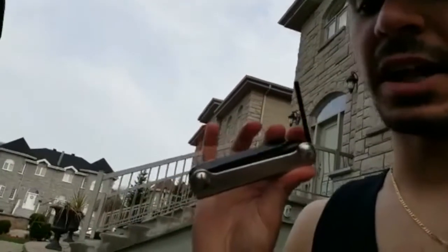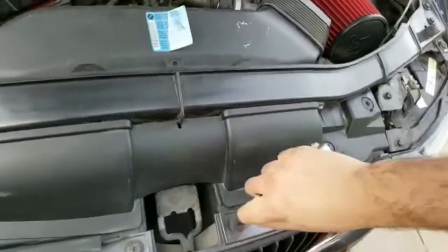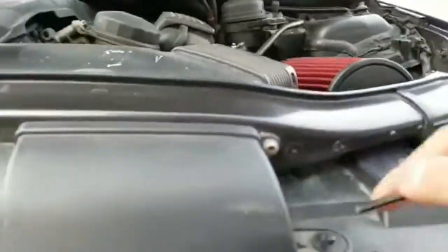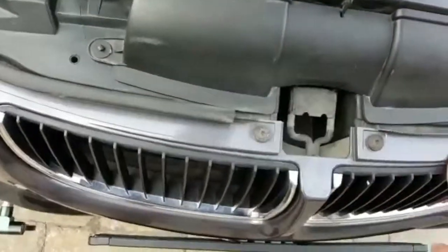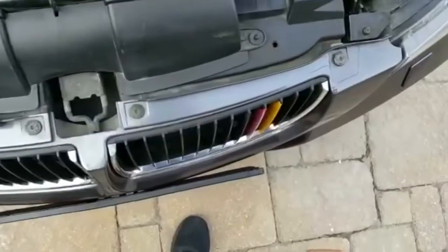I lied, we're also gonna be needing an Allen key — I don't know what size this is but it's best to have an Allen set. You're gonna need to take out these four bolts right here, and this one right in here. Once we take these off, this piece has another Allen key bolt you need to take out, then this just pops off. You can then slip in through right here so we can undo the tops.